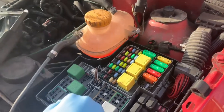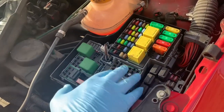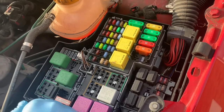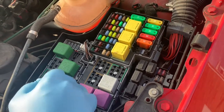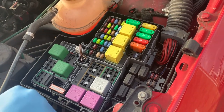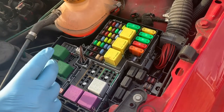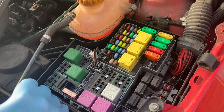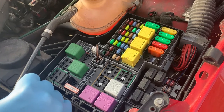So we've established that the alternator's not charging. I've been through and checked the charge relay and fuses — everything's good. I've also checked all the fuses just to make sure nothing seems amiss, everything seems fine. I've checked the back of the alternator and we're not getting the signal. It could be a harness problem, but I'm pretty much sure it's the alternator itself, so what we're going to do now is change the alternator.